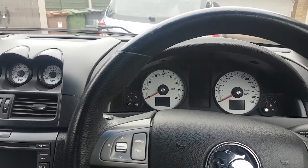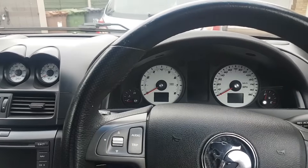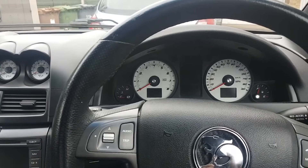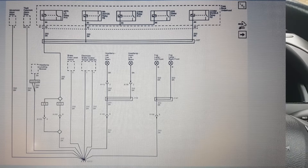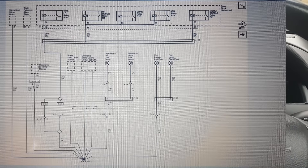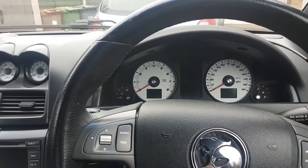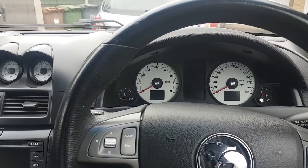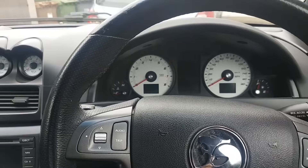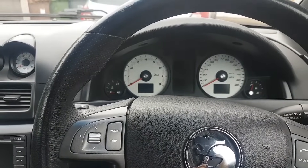The diagram shows that fixed ground point feeds loads of different things. I'm not going to say all those grounds were bad, because if they were we'd have way more issues - some of those grounds go to vital components. But my main theory is that under load, when power is being drawn through that ground, it may not have been enough and modules would start to behave oddly. That's what I suspect happened.